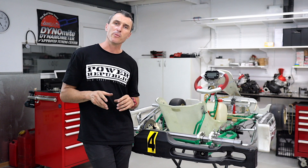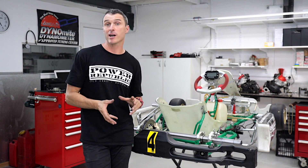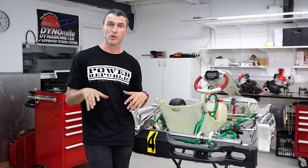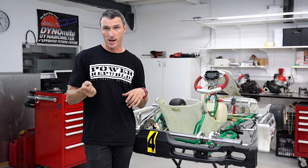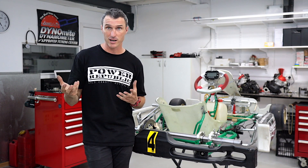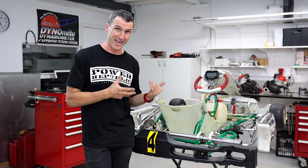The reason you're going to change the ride height in the rear is because you're not happy with the kart setup to some degree. Normally it comes in its factory setting which is in the middle position. The time you change the ride height on the go-kart is if you had some chronic oversteer, maybe in the wet or at a very slippery track, and as you came off the corner you just couldn't get a lot of rear grip in the axle.